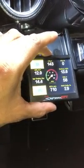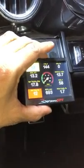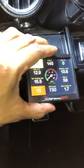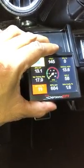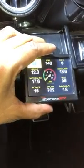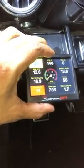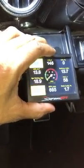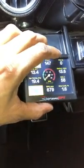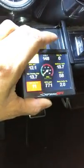This is the hunting idle that the Sniper EFI has given me. I'm mainly concerned with this IAC position opening and closing, opening and closing to try to keep the idle. See my temperature? It's not fully warmed up yet, but it seems to get worse as it fully warms up. TPS will always stay zero — that will never change unless I actually depress the throttle.